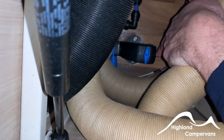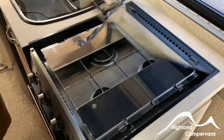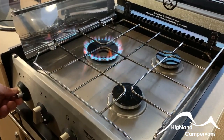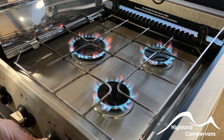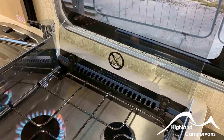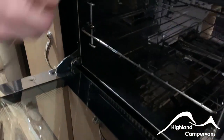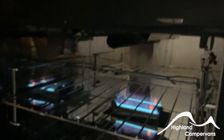Once you've done all that, turn your cold water taps on, draw the water through the system, then switch over to hot water. It'll take a little longer with the kitchen tap as it's on the other side of the vehicle — give it about two minutes for the whole tank to fill up. The gas hob and oven is fairly straightforward; use the electronic igniter on the front, go for the biggest burner first, hold it in for a few seconds, and work your way around them. There are no thermostatic lids, so make sure everything's cooled down before bringing the foils in and lowering the lid.